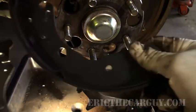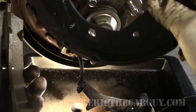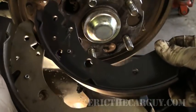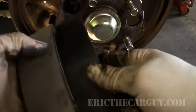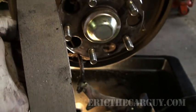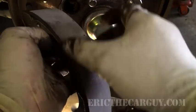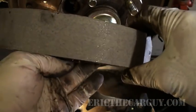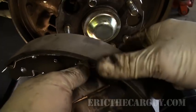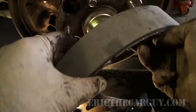Here's the new shoe — you can see it's already got a peg. If it didn't have one, all you would have to do is knock this out with a hammer. Lay them up side by side so you put it back in the same hole. Another trick: to avoid getting any contaminants on the outside of the shoe as you're doing the job, take a piece of masking tape and put it on the outside of the friction material so you don't contaminate it with brake dust. It makes for a much cleaner, nicer brake job.